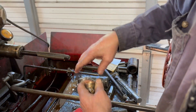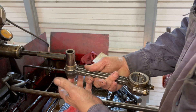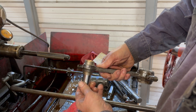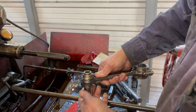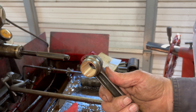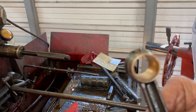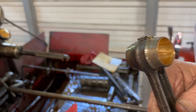I'll show you how the pin fits — just barely will fall through. I'll wash it off and then it will. It's the oil. You can see. Got a good job on that one. I hope this shows you and explains a little bit about bushing the rod. Quite a little work to do it. Thanks for watching.